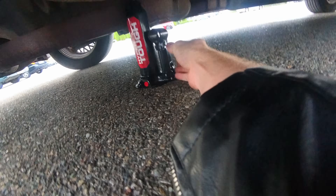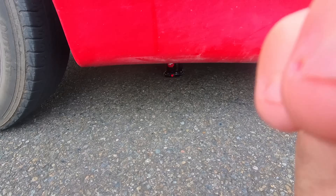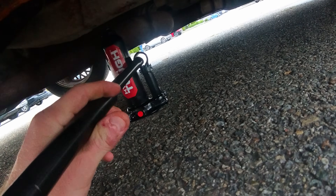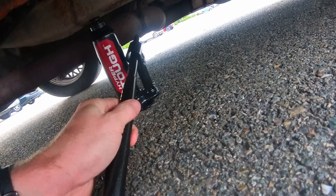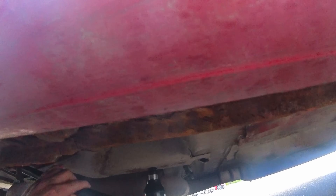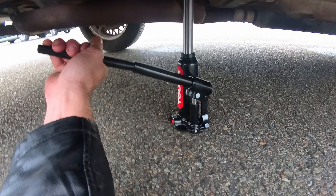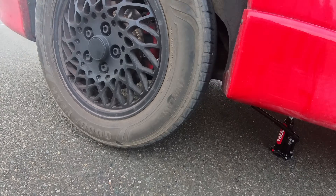As you can tell by the size of this, it's not a heavy-duty jack. It's 1.5 tons — I think that'll work. But with a jack like this you definitely want a jack stand, because this could fail, this could slip, this could fall. Okay, this is actually as tall as it goes — it barely clears the wheel. I'm going to go get a jack stand.